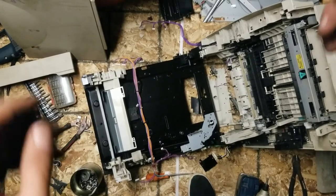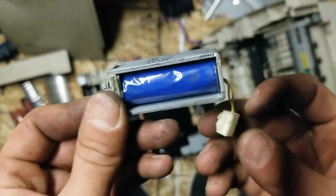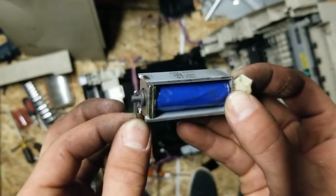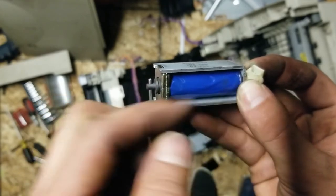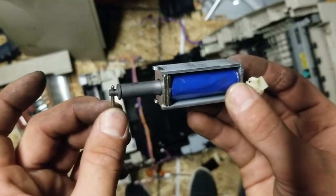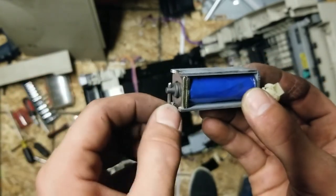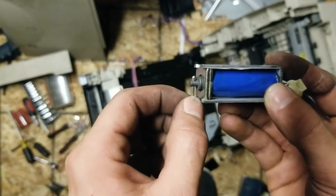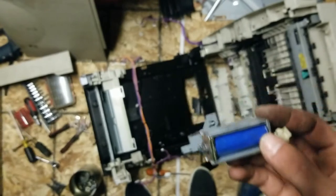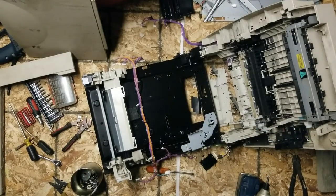So this, again, looks like an electronic solenoid. So voltage would be applied here and be transmitted into mechanical action by this coil, and its magnetic field induced by electricity put through it. It will move this slug up and down and actuate things. Obviously, this went to a gear of some kind and threw one gear into another, which activated something else and initiated this gear train. Very, very cool. That'll be over with the other actuator.